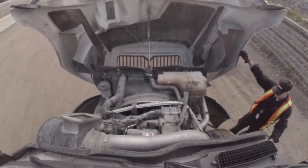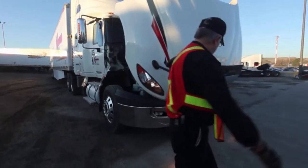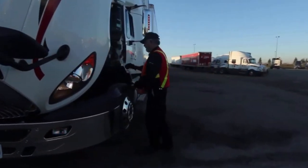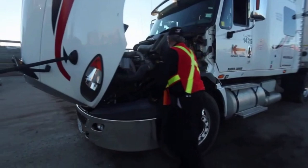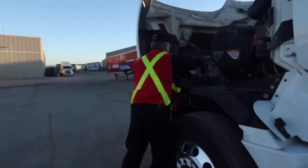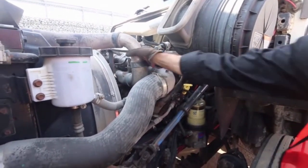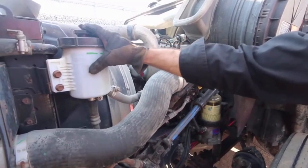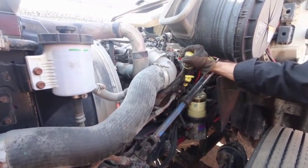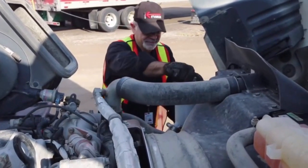Just like at the front, you're going to start at the top and work your way down. From the top of the engine, we use a variety of engines, so I'll be very general about what you should be looking for. The main thing you're looking for is to ensure all parts are solidly in place — there are no leaks, nothing's broken, nothing's damaged, nothing's leaking. You're looking at the radiator, the hoses, making sure nothing's leaking and everything is solid. Check that all the clamps are in place, they're not loose and there's no damage. Check the power steering fluid to make sure it's up to the minimum cold level.